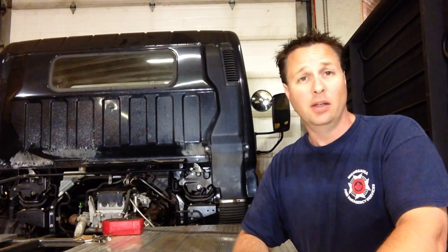Steel — the rest of my deck is made of steel and the subframe is steel — but steel is heavy, especially when you get into plating. So I'm using 6061 aluminum extrusion: very lightweight, it's not going to warp, it's not going to twist, and it's never going to rust. If you do choose to build a steel subframe with aluminum decking over it, make sure you put some isolation in between the steel and the aluminum, because when they get a little bit of salt water in between them they don't get along very well and the aluminum will be on the losing end. Anywhere where I have aluminum coming up against steel, there is an isolation barrier of a dielectric plastic in between the two.